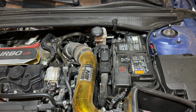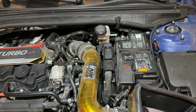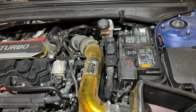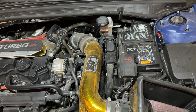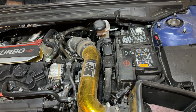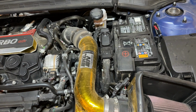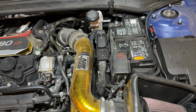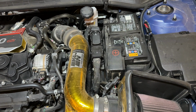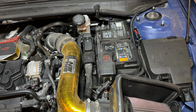So somebody might be wondering, why do I disconnect the battery and why wait? Because if you look at the other videos and learn from others, it's basically how the Optimas, you had to wait like 5 minutes to disconnect the battery and let the system fully discharge before you disconnect the airbag. Again, these have, I guess, capacitors, and capacitors hold energy, just in case in an accident, you can still have your airbag go off if something goes bad with the power. So just as a safety precaution, you just want to wait.